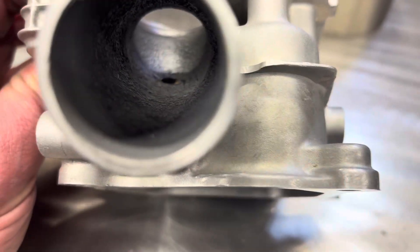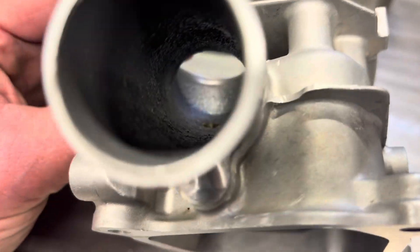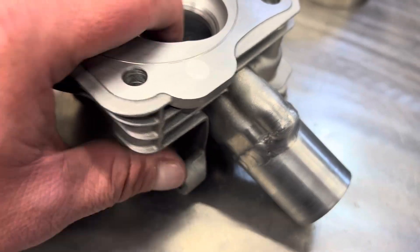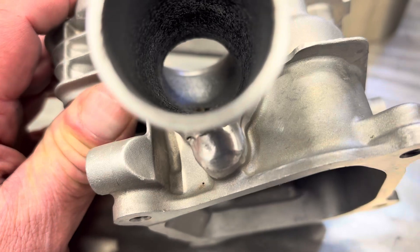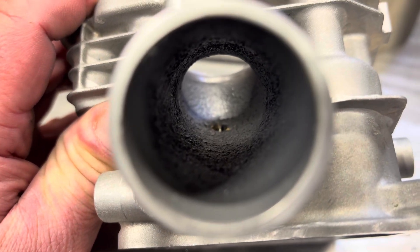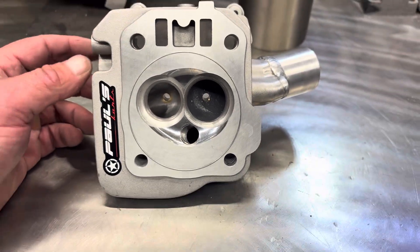This one's running M5. The epoxy not only allows us to shape that back corner and allow that radius, but we also build up a little bit right on the left-hand side in that corner and back in there. Then we apply the texture. The texture actually really helps keep fuel atomized. Especially with methanol — it's a very heavy fuel, a very cold fuel. The cold fuel is going to bring you a ton of power, just really cools the air down. Nothing really makes more power than cold fuel.